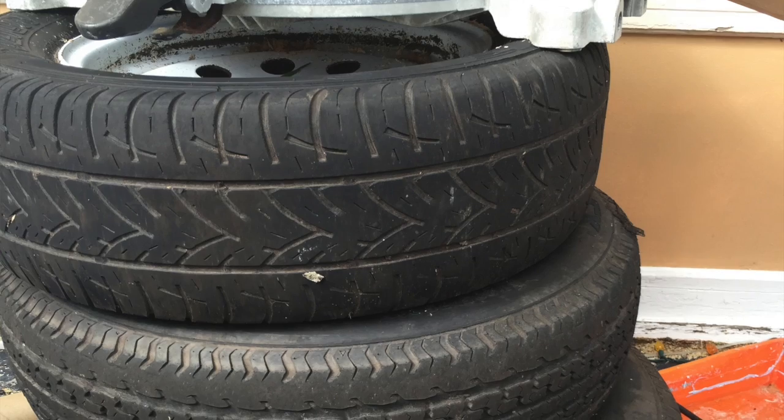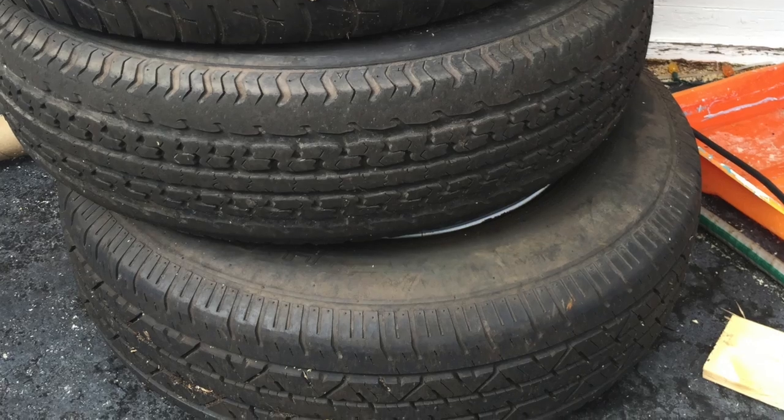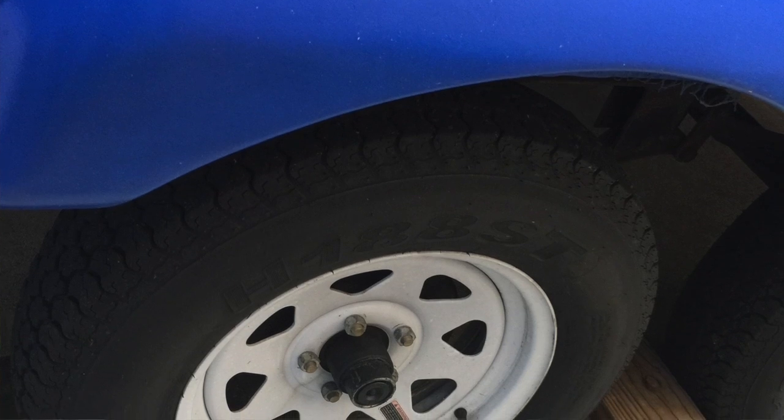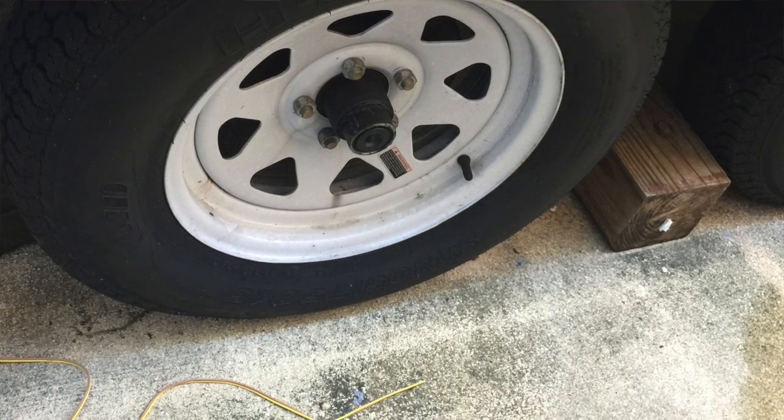And this brings me to the tires. I shall remind my audience once again that this qualifies 100% as a carny trailer. Two of the tires were 15s — one on a 14-inch rim and the other on a 16-inch. Three were what I would consider extremely bald. I got very lucky, however: one tire was mounted on a 15-inch rim and was in great condition, so that became my spare. I found a great deal on Amazon — $260 for a set of brand new E-rated tires and rims. Oh, and did I mention the original tires were only C-rated?